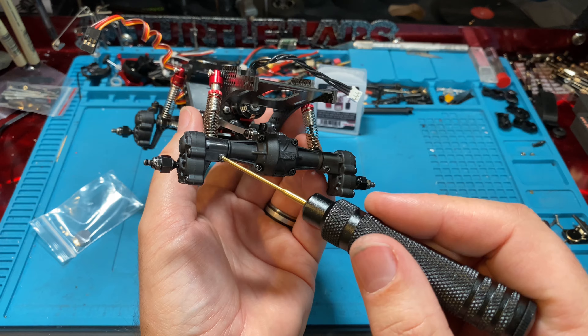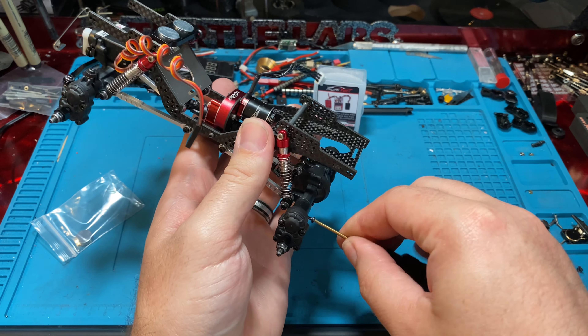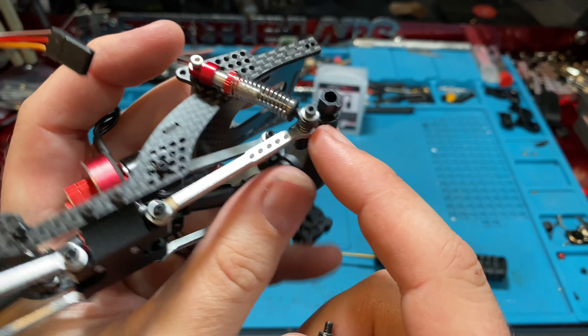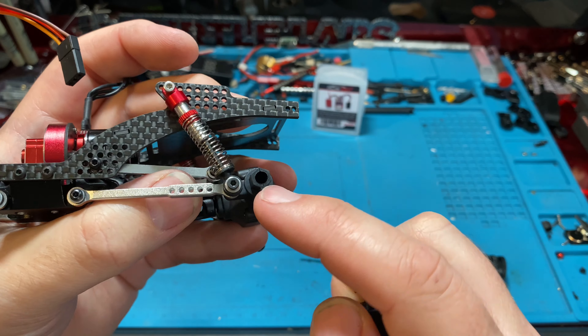Another thing about these portals — on the rear you can actually pull these off and clock them. You can turn it sideways. The new ones have little tabs on them that want you to keep them in position, but all you have to do is dremel or exacto blade that tab off, and you can turn your portal to lower the truck or get crazy with it. You can shorten your wheelbase, lengthen your wheelbase, lower it, or max your clearance. We're actually running them clocked on our monster truck.